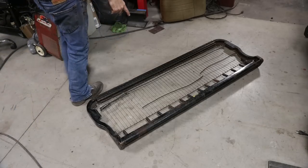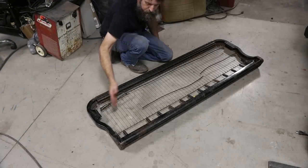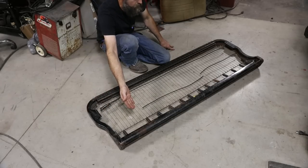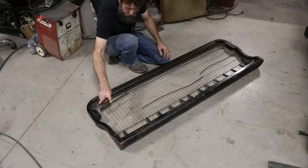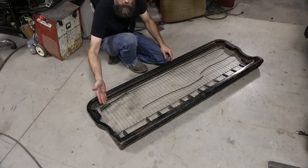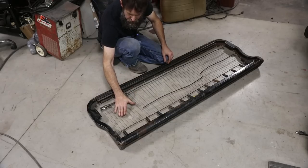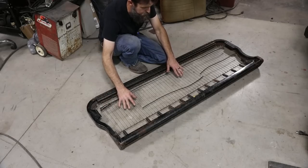So this bottom seat frame is shockingly good. Usually it's broken in two on the driver's side from people dragging their carcass in and out on that end constantly. They're rotted out from back sweat a lot of times. This one's not. It is cracked on the driver's side in two places, and one place, as far as I've seen, on the passenger side, but it's not broken in two like they normally are. Really weak because of those missing springs and a stretched spring. So we'll replace that, and that'll stiffen the support up here.